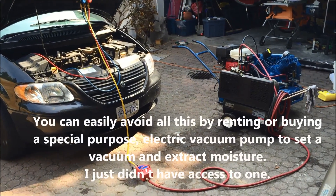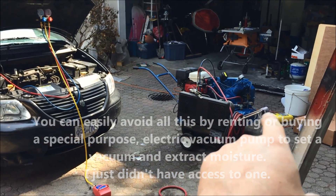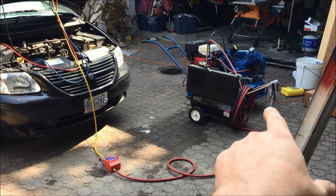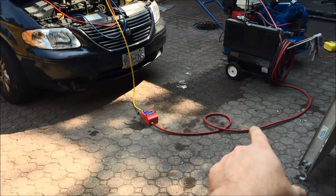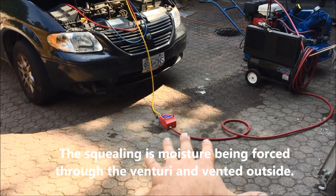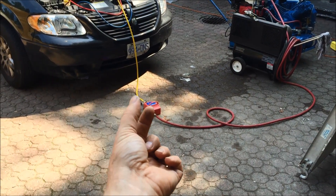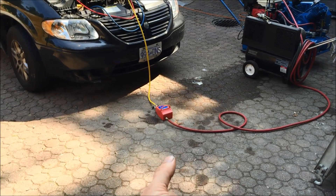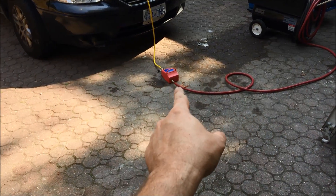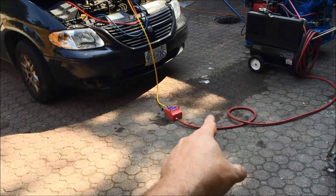This is loud so I'll try and speak up. I've got a 21 CFM compressor — it's just enough. The one down there is about 10 CFM and that wasn't strong enough. What I'm doing is I've got the air compression hose connected to a little vacuum pump down there. It's not mechanical at all — there's a Venturi in it, more like a carburetor Venturi. It's a tapered metal chamber that creates a vacuum. Compressed air flows into it, forcing out through the Venturi chamber, and that creates a vacuum on one end of the Venturi.